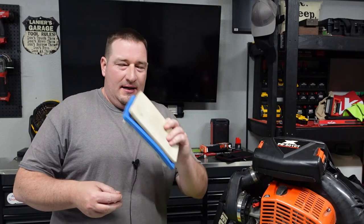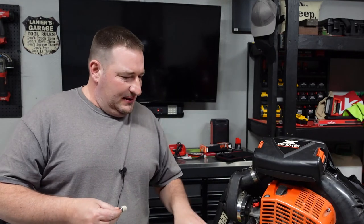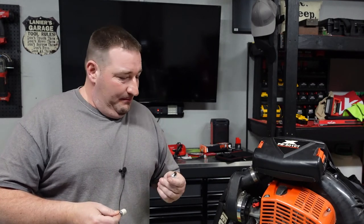And just like that, that's how you change the air filter, the fuel filter, and the spark plug. All this is done in less than five minutes, so it goes pretty quick. It's the beginning of the season — that's when I like doing all my maintenance. Usually I do the blower once a year, depending on how much dirt and dust. If the air filter starts getting a lot and I start noticing a lot of debris in the tank, then I like pouring out that old stuff, trying to get it out of the tank, and changing the fuel filter anyway. Thanks for watching, guys — don't forget to like, comment, and subscribe.